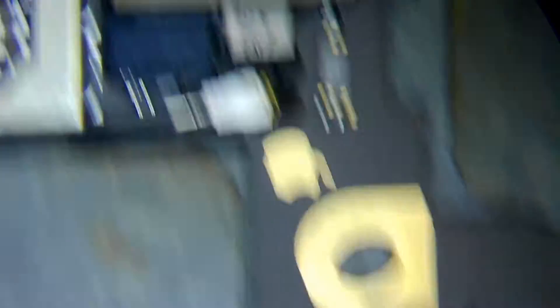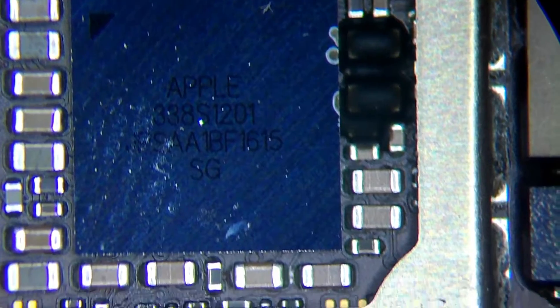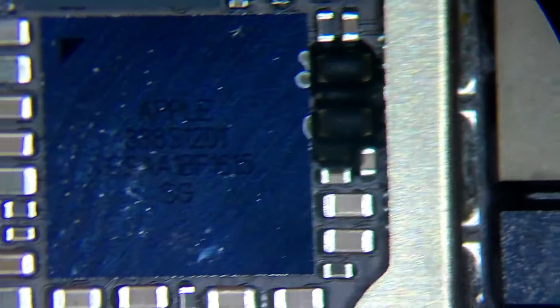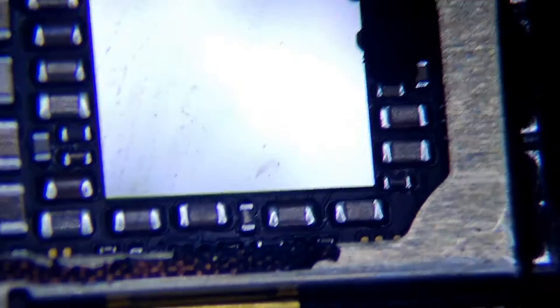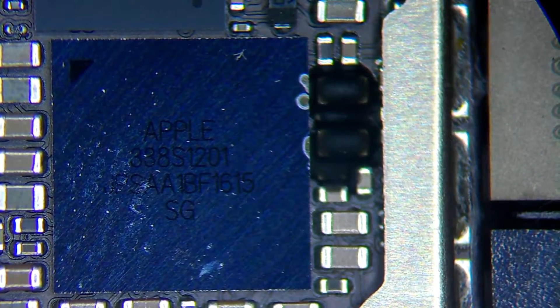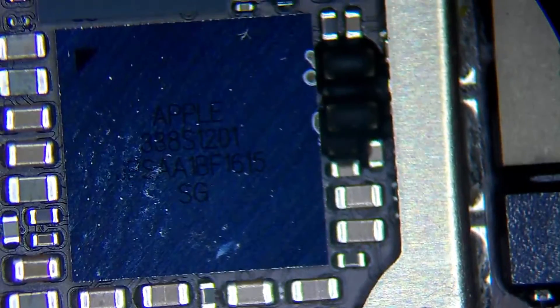So now we are gonna look under the microscope, see if there is any kind of damage that we can see. But if we can't see anything, we are gonna try to replace the audio chip. I don't see anything weird. The chip itself is not cracked. If it was cracked, I think the phone would be fully shorted to ground. But I can't see anything like that here, so I guess it's an internal problem.